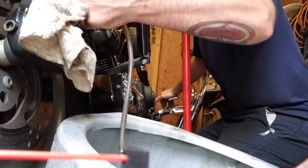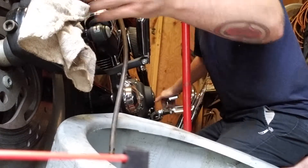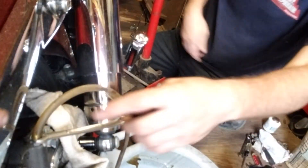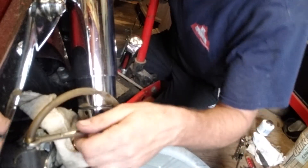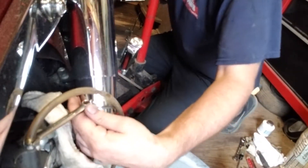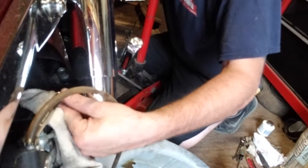I was trying the pump-it-up thing and I've never had luck with that on bikes. If you watch this tube — the fluid stops there, and with pressure on the pedal you can see a couple of air bubbles roll out. That's an 08 FXDF Dyna Fat Bob — I love this bike.